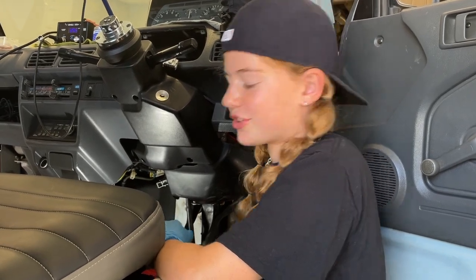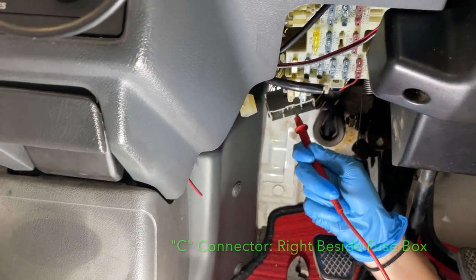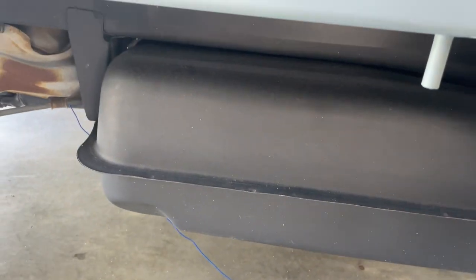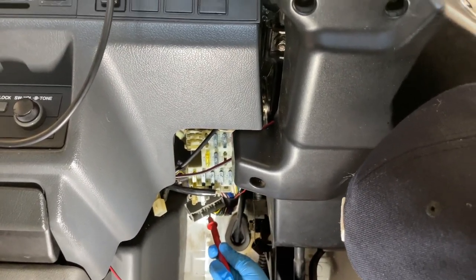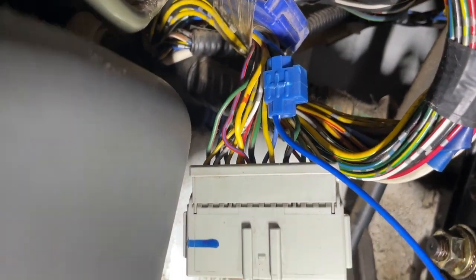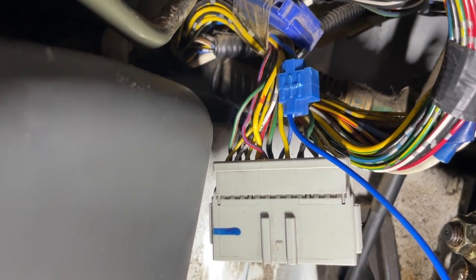Now we're looking for the tach signal for the cluster. BK has identified where we're going to tap in — the C connector underneath there is picking up the tach signal. There's a cool jumper scheme here that runs all the way back underneath the truck to the ignition coil. In lieu of tapping at the coil, we're going to tap right in at the plug you'll find behind your fuse box. There's a solid blue wire coming from the chassis side — tap right into it and run that blue wire up to the blue wire in the cluster pigtail. That will provide your tachometer signal.